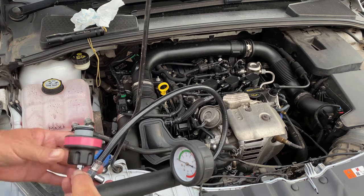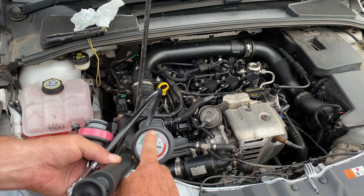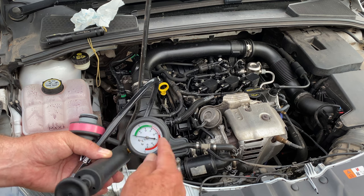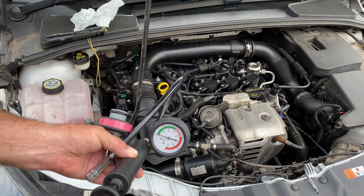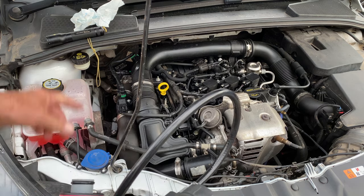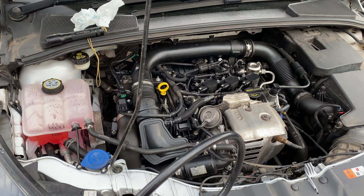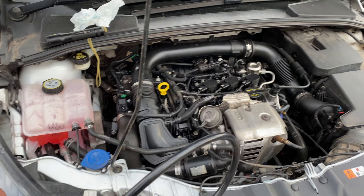That's the killer for all Fords — the heater matrix — so that's the problem solved. This bit of kit has been used to diagnose the problem by putting it under pressure. The first time I took it up to the green and left it for about 10 minutes, it lost about one or two PSI. Then I put it under higher pressure just to see if I could see it leaking anywhere in the engine. Luckily the whole carpet inside the footwell is slightly damp, so it's been leaking for about a week or two. Problem solved. The next video will be to take the whole dashboard out — which should be a lot of fun.